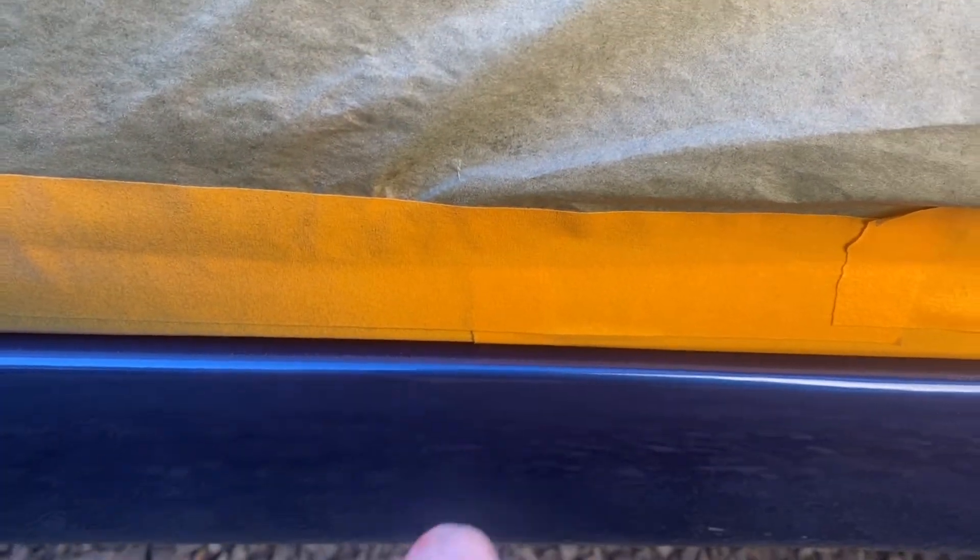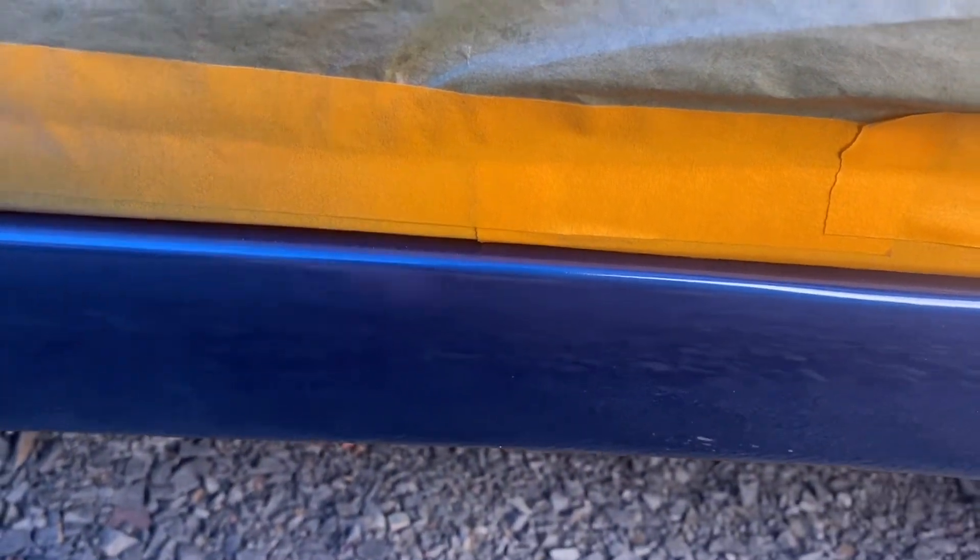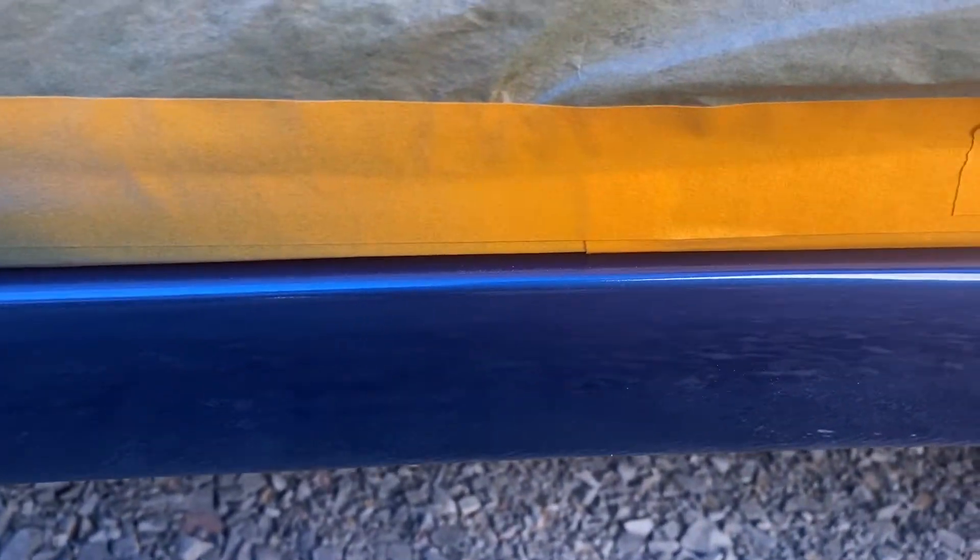Oh yeah, she's beautiful. The last coat's done. I threw that blend in right there — you can't even tell. Paint stopped there. Clear coat stopped there. That's the old clear coat — you can tell because there's a little tiny rock chip right there that we didn't take care of, but they need this car done quick anyway. We threw that blend in right here and you can't even tell. Nice and shiny. Looks great — that blend stuff does wonders. At this point it's done. We're just going to wait for it to dry up — I'll give it about 45 minutes, keep hitting it with the heat gun, peel the tape, and this thing's ready to go back out on the lot.